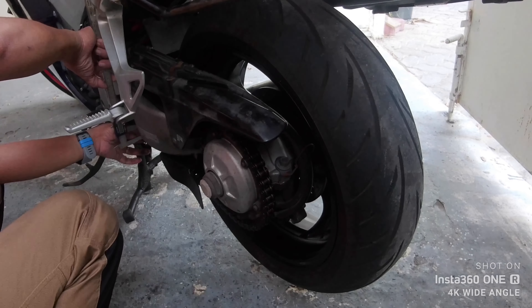There is no deformity at all. The deformity I'm talking about is when the tooth shape becomes uneven — it should be symmetrically pointed, but force in one direction causes it to point more toward the rear. So if you regularly lube your chain and adjust the slack correctly, it will lengthen both the chain's life and your sprocket's life. Hope you got something from this video — don't forget to like and subscribe. Peace!